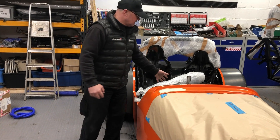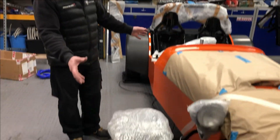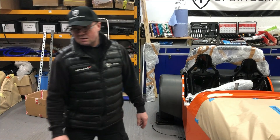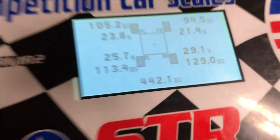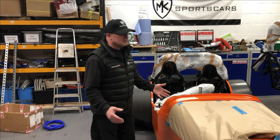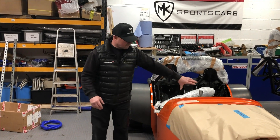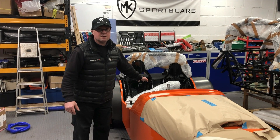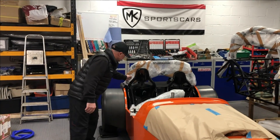There are just a few tiny bits to go in — even the gauges are in there. We've just got fluids to add really, and the wheels and tyres will change because we're going to a smaller CXR six-inch all-round with 185s rather than 205s. Oil and water basically, that is it. She comes in at 442 kilos — I'm pretty happy with that. We're trying to get around 440 kilos, and I think by the time we've done fluids she'll just touch 450. All the bulkheads, wiring, the whole cabin bay is in there — including the electric reverse motor, all the cabling and switches.